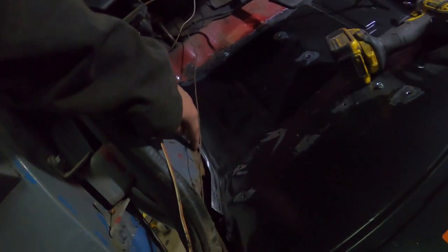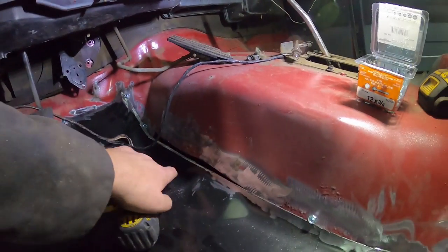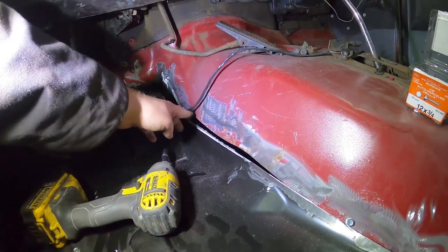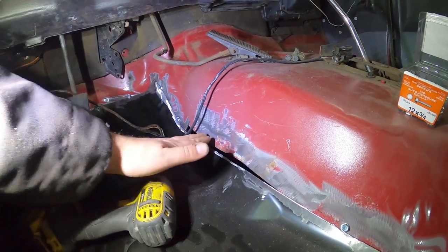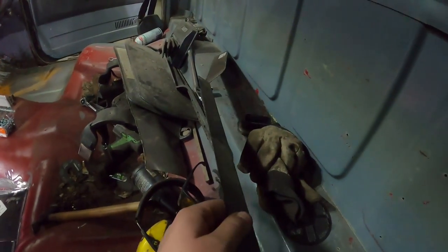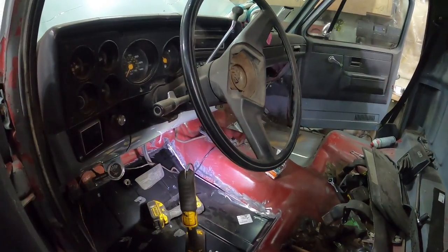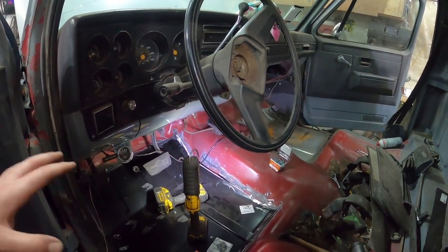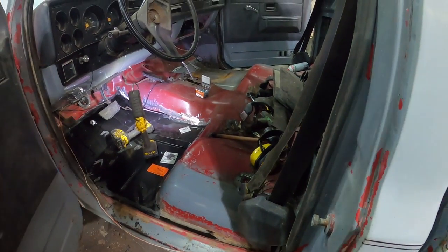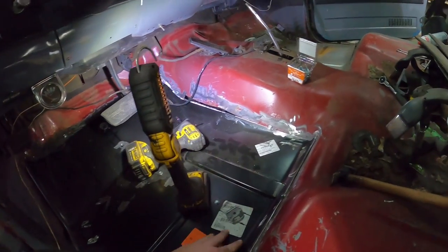Around here I'm going to need to build up a little bit because it's more rusty. And here - same thing. Even the metal down there is still kind of meh. So I'll just cut it up and around and do the same thing - put a little patch in, and I've got leftover same gauge steel for these radius things. A little bit more welding and I'll just grind it down. Then I can move on to the side piece, and then underneath it'll be super easy because it doesn't have to look pretty - it's just a little bit more support.